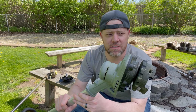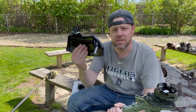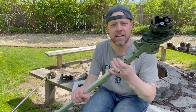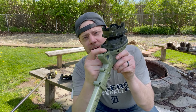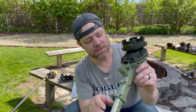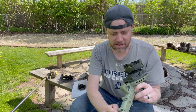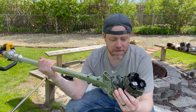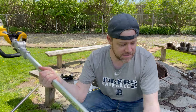What I found is that a lot of dirt and debris can get in here, especially after consistent use for a few minutes of solid runtime — and also if you choose not to use the shield. There's a spot right here on the back side, a big gap that feeds directly into the actual housing unit where the motor is, and I realized this thing was just covered in debris, dirt, and grass everywhere.